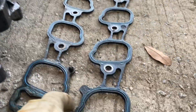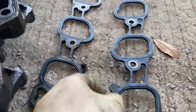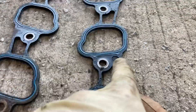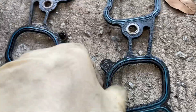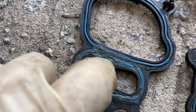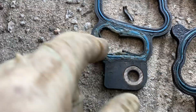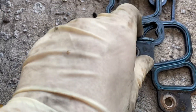Here are the intake gaskets from the Ford motor company for a good Ford 4.6 liter. The car I'm working on had the original ones — you can still see it's an '07 but the gasket was made in '06. And here's where it breached, right here. Typical, typical. The gasket chunked out, broke apart, and started leaking.